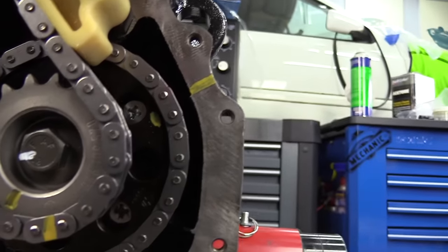I also made yellow marks for the camshafts where they line up in the keyway for the gear as yet another quick check to make sure it's timed properly. You'll notice that the marks on the chain do not line up with the marks on the teeth — that's okay. It'll take around 160-some odd revolutions before that stuff will all line up again. We only care about the marks that the factory provided us and the additional ones we made, which do not relate to lining the chain up to the gear in a certain position. All right guys, so there you have it — one fully and correctly timed VR6 engine. I hope this will help you time not only a VR6 but any engine, as this strategy applies to pretty much everything out there timing-wise.